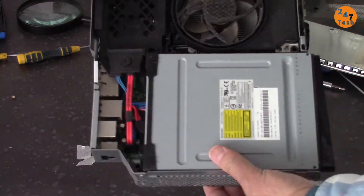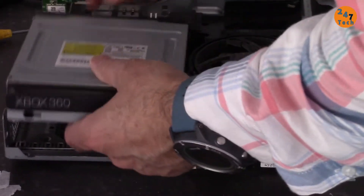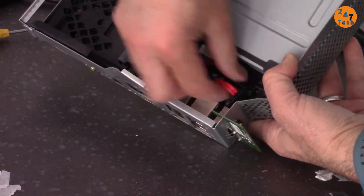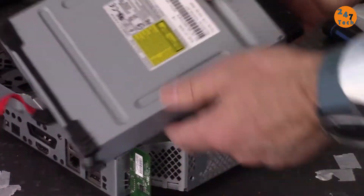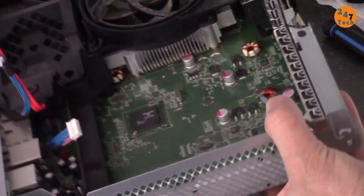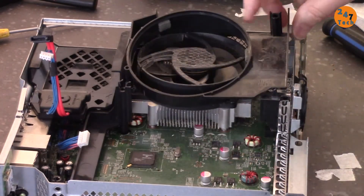Here is what you have access to. I'm going to open this portion and clean up the heatsink, but before that let's remove the CD drive — the CD drive is just loose, it needs the wires to be detached. Let's remove the hard drive wire first, and after that remove this. Let's see if there is any dust underneath because the fan is working perfectly, but why it says heating up — I have to check that. This was just a simple piece that was holding it.